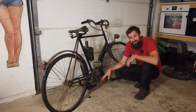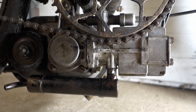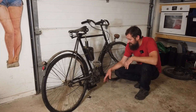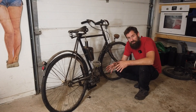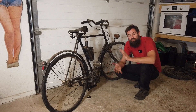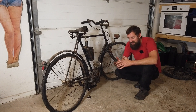Not only is this a very tiny engine, this is also a diesel engine. Actually, it's built to run on a lot of different kinds of fuels — paraffin and stuff like that. If you know a little bit about diesel engines, you will know that they rely on self-ignition. There is no spark plug — nothing to ignite the mixture other than compression itself. And for that to be possible, the compression needs to be pretty high.